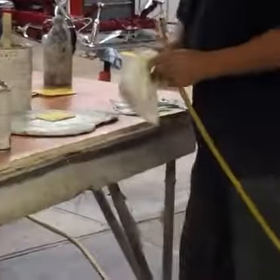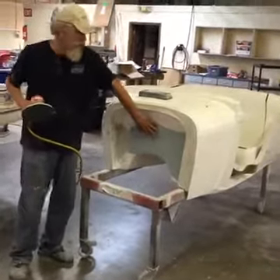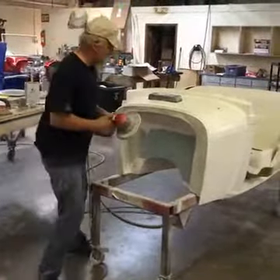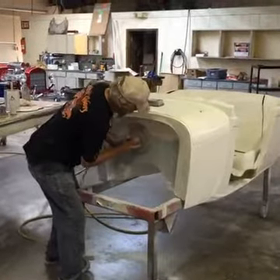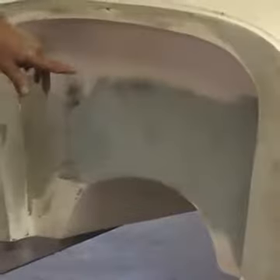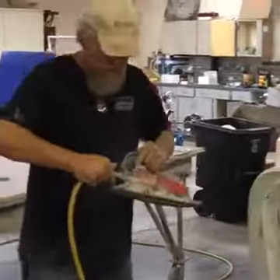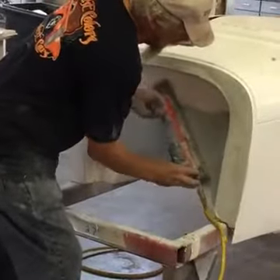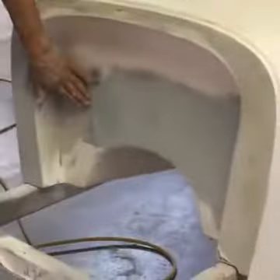I can still stick my finger into it — it's a little softer than I would want it to sand with. I like the Mud Hog. You can see here, almost like a guide coat, where I've sanded. This Mud Hog does a really good job of keeping things straight and does a good job going around curves, so it's really a multi-purpose tool. The air file also does a good job of staying straight. But you can see I'm having a little difficulty getting in there — the divot's still there, and I'm still high in this area.